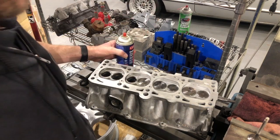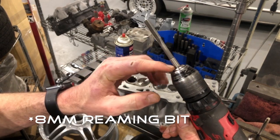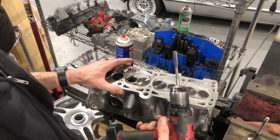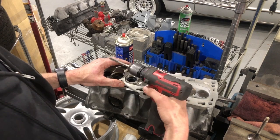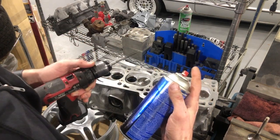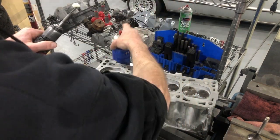You need some cutting oil and an 8mm honing bit. You can get them with a tap end or a drill end. I would normally use the mill, but for video purposes I'm going to use a drill because most people have drills and don't have a mill.